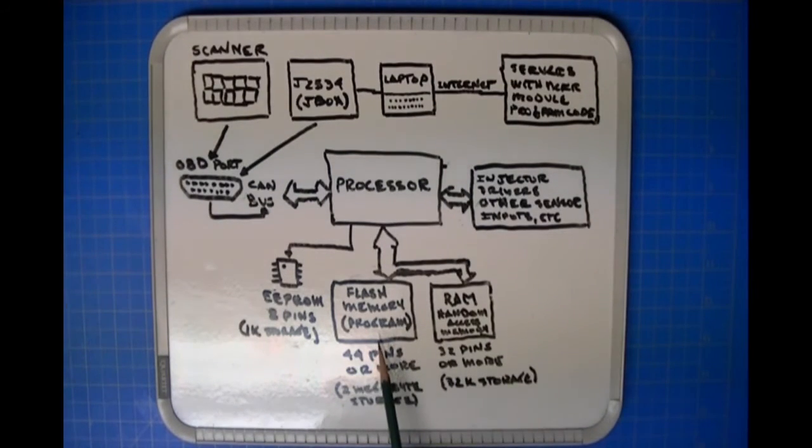And I know, if you've watched videos of guys that are doing programming, they've got stabilizers they put on the battery because they say, we don't want the voltage to drop below 14 or whatever the parameters are that the manufacturers say it shouldn't do. Because basically you're erasing the program, and that's what the communication program does. Then it erases the program in the flash memory.